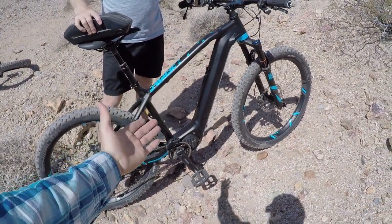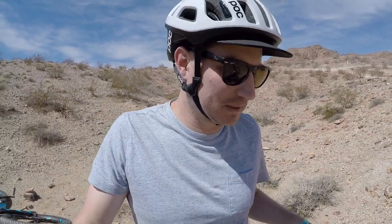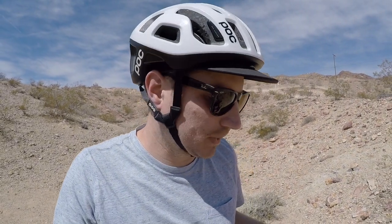This motor produces up to 70 Newton meters of torque. Shimano had some marketing calling it the first e-mountain bike specific mid-drive, which is surprising given the Bosch Performance CX motor at 75 Newton meters exists — and Bosch now has the e-mountain bike mode which is more dynamic. I think it's becoming a competitive space, which is great for innovation. Maybe their marketing materials are a year and a half old and they just didn't know at the time.